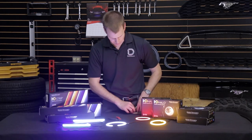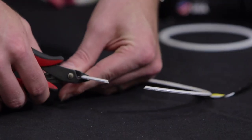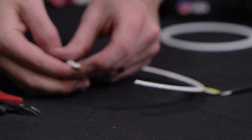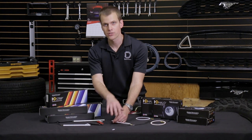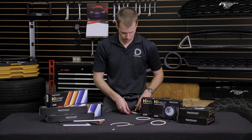If we need to, we can turn it off and cut off a little bit more. Don't pick up scissors when you go to do this — you want to use a pair of side cutters. That's the only thing that will give you a nice clean cut. You don't want to file it down or anything; if you do that you might risk bridging the electrical traces together. Just stick with the snips — that's all you need to do.